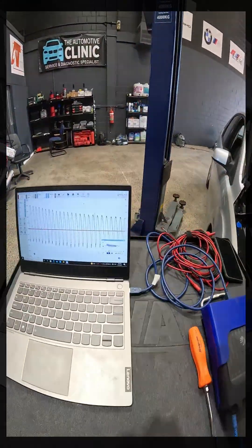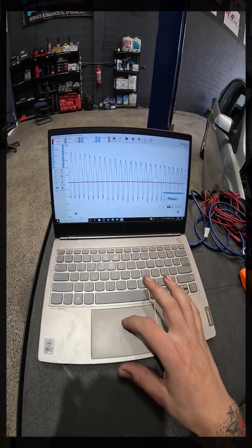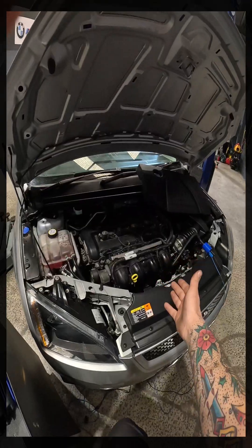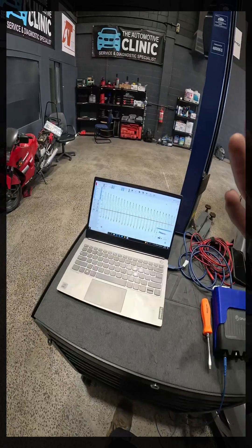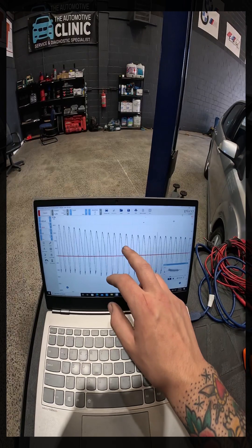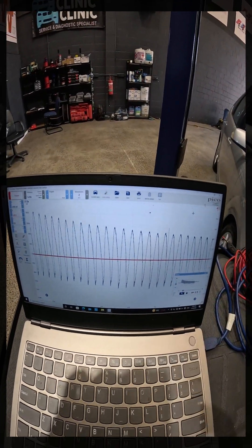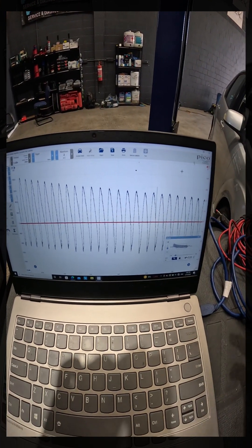Obviously there is no problem with this car, so this is great. What you would see — and what you're definitely looking for — is a deviation. If we do this test on a vehicle with a dead miss on cylinder three, and our relative compression test is hooked up and we have substantially less intake vacuum on our cylinder three hump, then we know that we're looking at an intake sealing issue or an intake valve issue.